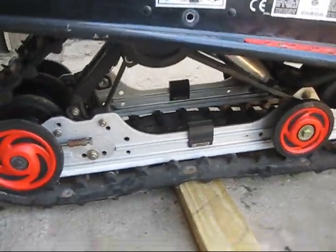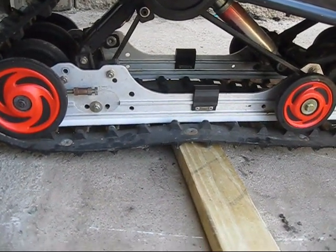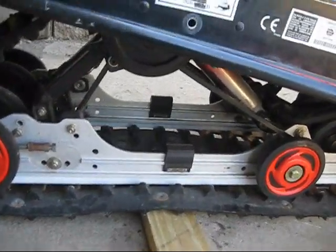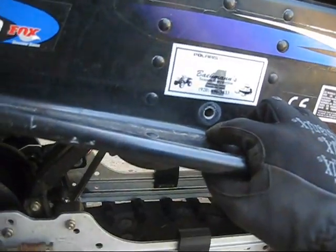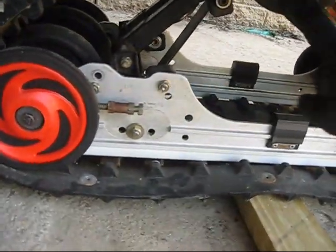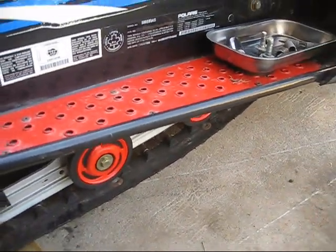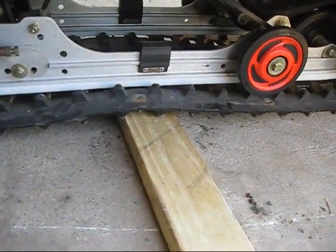Once you do that, you want to start pulling your suspension bolts. It's 4 bolts. I recommend if you got an air impact, use that. It's much easier. Without that, these tend to just sit there and spin. They're pretty hard to get out. But I just got them out. Took a couple tries. I had to loosen them, tighten them one side, and just kind of get them even. And they pulled out. Now I gotta do the front.